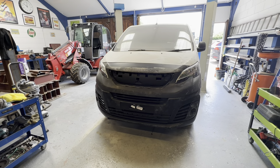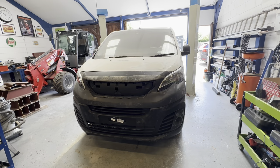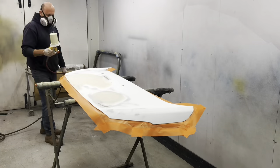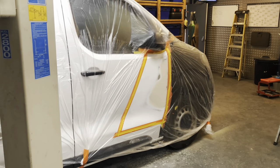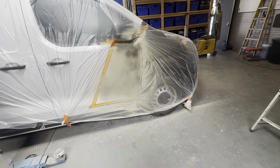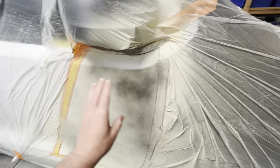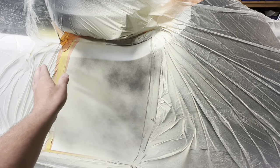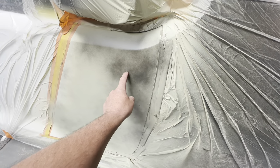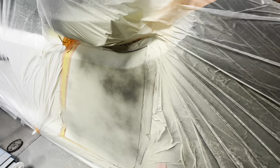He's not going to video blowing it off with the airline but he'll get it masked up and get some primer on. Straight on to the tack cloth, bit of cleaner - one rag to wipe on the panel wipe, one rag to wipe it off. A lot of people make the mistake of using one rag and end up contaminating it. On with all the primer, all the way around the whole van - all done, all primered. This morning put a bit of guide coat over the top. The guide coat highlights low spots - when you rub it down, any low spot will stay black with those dots, so that's what a guide coat is for.